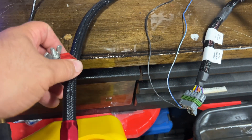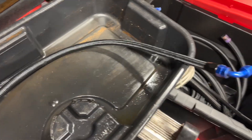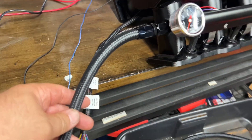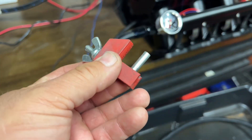These hoses do get brittle after a few years, so I always recommend using PTFE hoses. Quick tip: if you ever have these rubber braided hoses that are still recommended for fuel, if they start feeling stiff, I probably wouldn't reuse them or even use them at all. These rubber hoses I mainly use for transmission cooler lines. For fuel systems, I definitely recommend PTFE hoses. All right, so we got two newer hoses. We're going to clamp them down again and check our fuel pressure to see if it increases, then check our spray pattern on the injector.